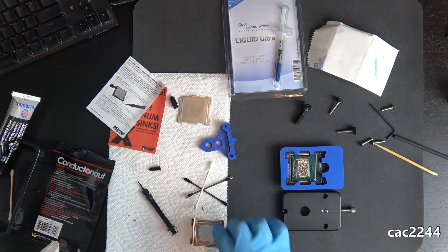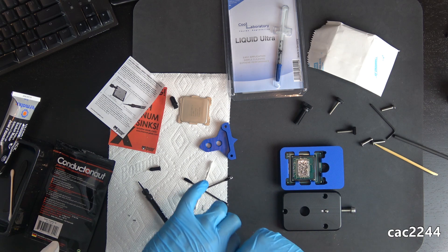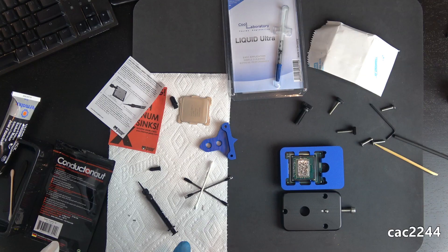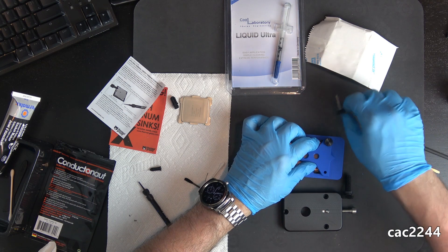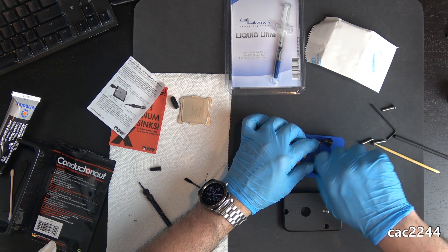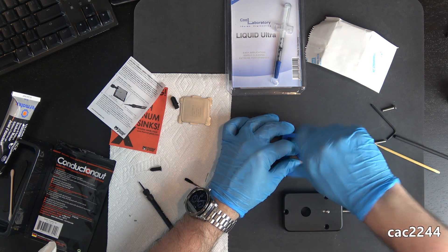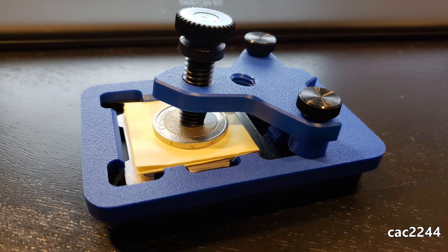The secret is to not put too much adhesive, or you'll create a larger gap than necessary, which will adversely affect thermal performance by reducing contact between the die and the IHS. For clamping, put the rectangular plastic positioning bracket on top of the bottom part of the jig, then the clamping plastic triangle on top, and tighten the screws. I found the triangle plastic jig would bend easily, causing the screw to go diagonally and dent the copper IHS, so I folded a post-it note and placed a coin on top to even out the pressure and avoid scratching.